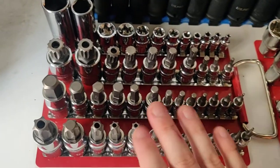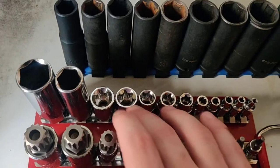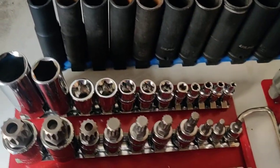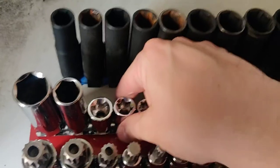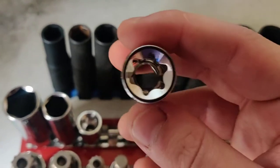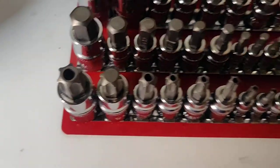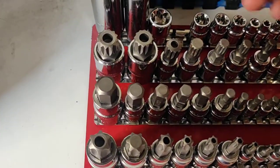Your e-torx are extremely common on your Mercedes and also on your Vauxhall — because obviously Vauxhall is Opel, it's German. You get these a hell of a lot on the Vauxhalls; I think pretty much every single bolt on a Vectra is actually an e-torx. These are really, really important to get hold of. As you can see, it's just a female relief of the torx shape, but they're not inter-sized — so for example that's not an E60 even though that's a T60. They're not interchangeable.